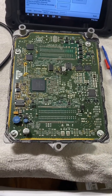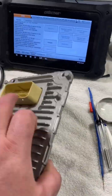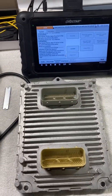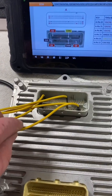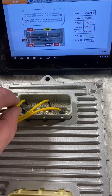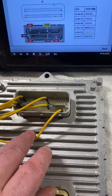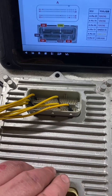So we get it open — first things first, we've got to connect our OBD Star. Once we have those hooked up, it's actually only five wires minimum: your two positives, a ground, and your CAN low and CAN high. You don't need this extra positive but I hook it up anyway — it'll read and write just fine without it.